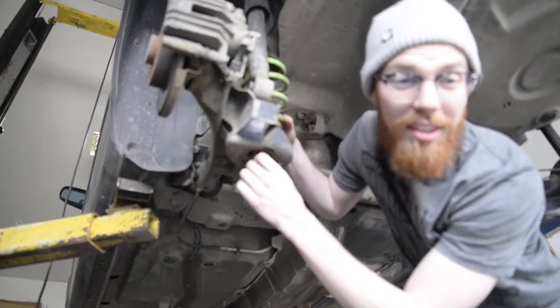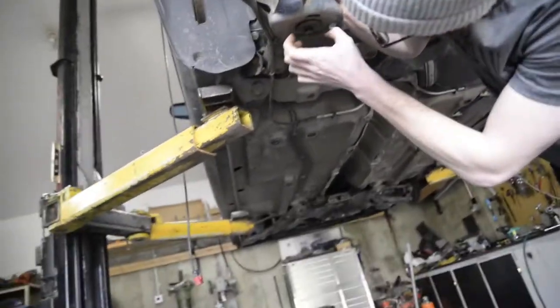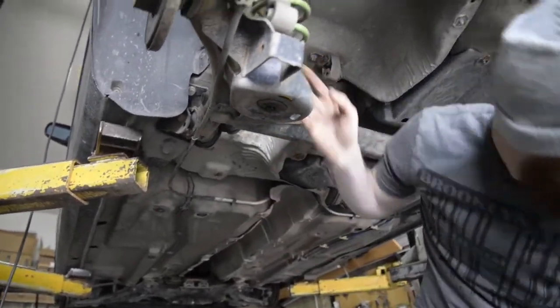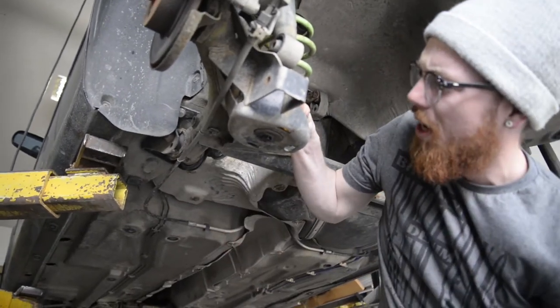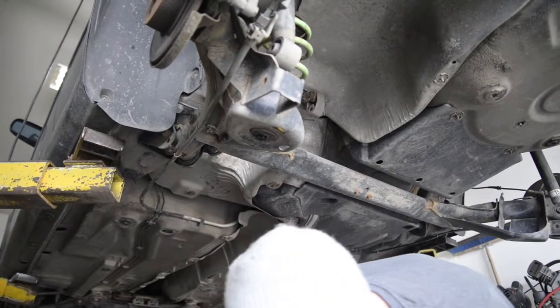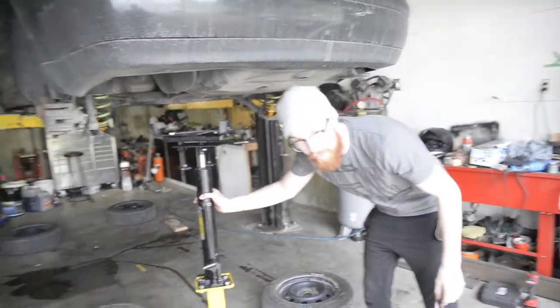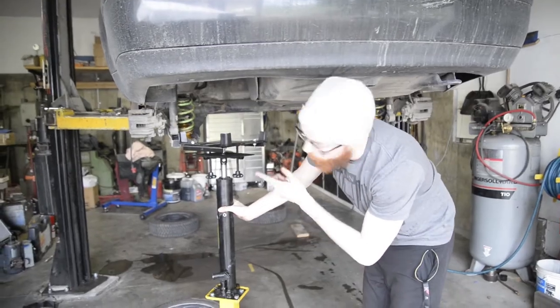What's the chances this is also a 17? That socket on there — is that correct? Did you switch it to a 16, Carl? Oh did I? Well, what's the chances this is a 16? It's a 17. Was it an 18? Yeah, look at that — it was an 18. Torque to spec. Since we're on the hoist, I'm gonna use the trans jack. But if you don't have a hoist, you can do this on the floor with a floor jack — you're just gonna have to jack the swing axle back up so you can put the bolts in again.